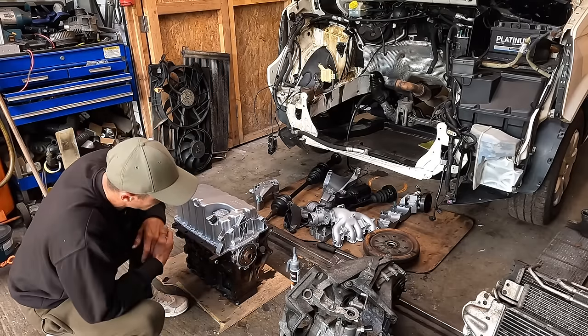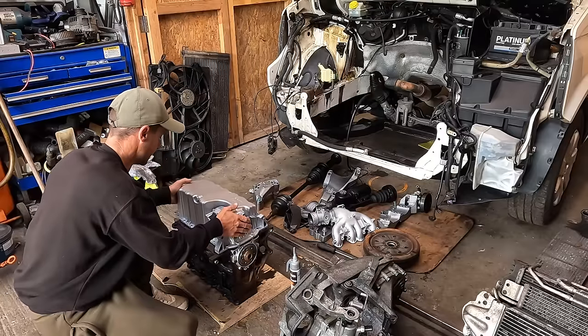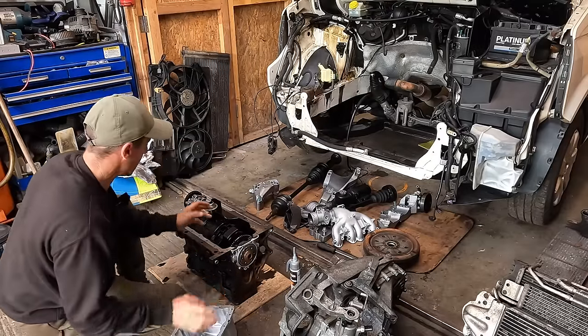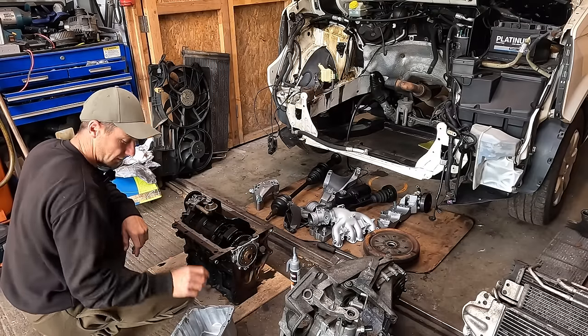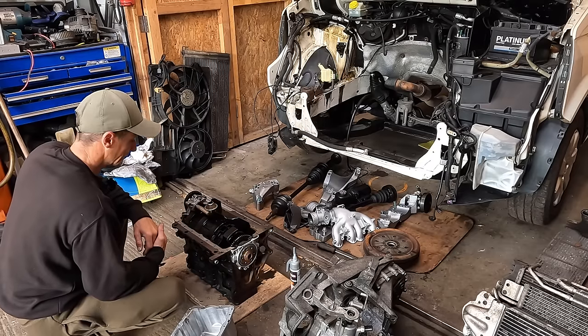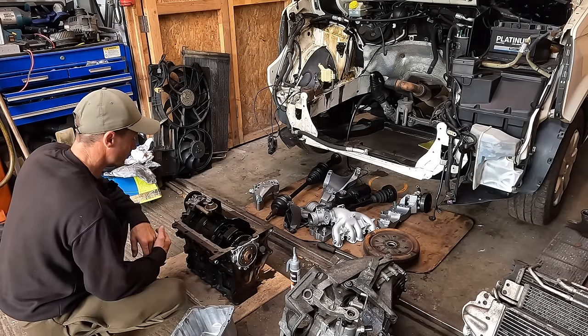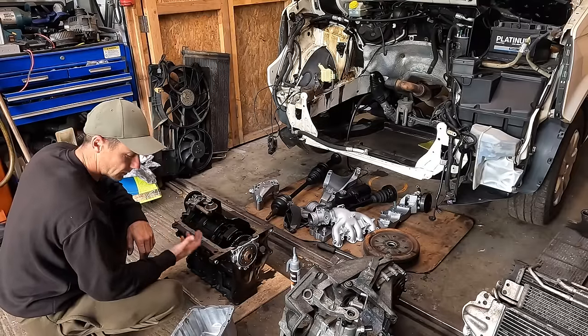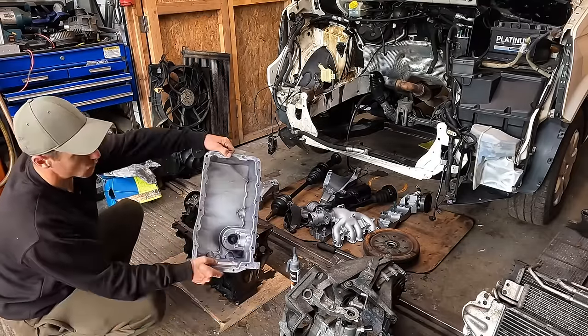We've got the new crankshaft oil seal on. We've got the T5 sump and the T5 oil pickup pipe. Because we've got a deeper sump, this oil pickup pipe is a bit longer. Yeah, we've got all the windage tray from the T5. I have given it a bit of a clean up in there. You want to clean up, and I have cleaned in the sump.